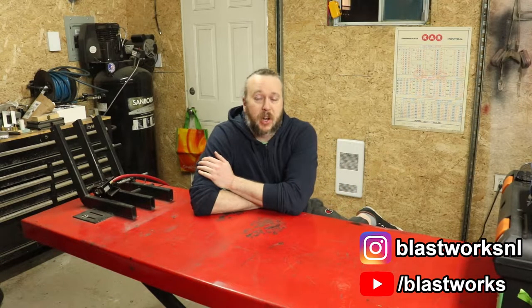So yeah, cameraman is right. It's been a while. I actually did start recording part 9 of the C70 series, and it was essentially going to be the wheel rebuild. So I had taken the wheels apart, ordered new tires, new brakes, new bearings. Then in a recent video, I did up my own nickel plating solutions. I was going to clean up the spokes and re-nickel plate those myself. Wasn't getting the results I wanted, so I ordered all new spokes and 2 brand new rims.